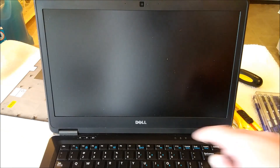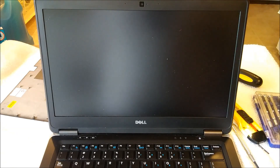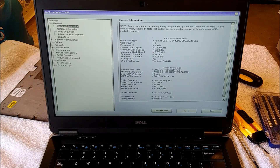No fire, no bad sounds yet. Let's get our F12 key ready — I'm betting that's what we need. Preparing one-time boot. BIOS setup, system information. Yeah, it's doing what I was afraid it was going to do — it's assigning the two-terabyte hard drive as the primary and the actual SSD as the secondary. So we need to see if we can change that. But otherwise, that looks fine.